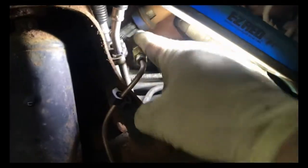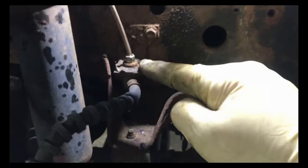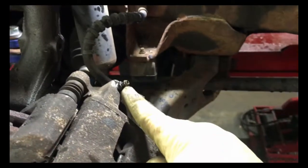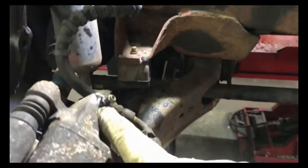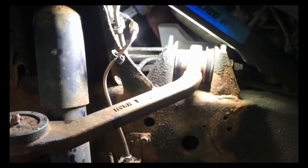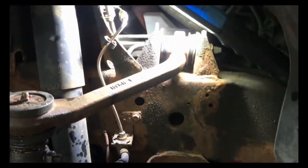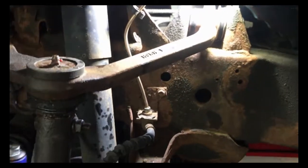I've got the line in up top, routed properly. Here's the union — it's not rubbing on anything, not rubbing on the fuel lines. It comes down through the original holder right down to the original brake line. I put a new nut on here, which is three-eighths, and it's tight. Here's another helpful hint on bleeders: they've been rusting in really bad lately. If I can get them out, I always remove them and put anti-seize on them. After that I used my vacuum bleeder to suck the fluid through. I'll get in and make sure the pedal feels good. This is the overview on how to change a brake line on a car. Thanks for watching — please subscribe and give me a thumbs up if you liked it.